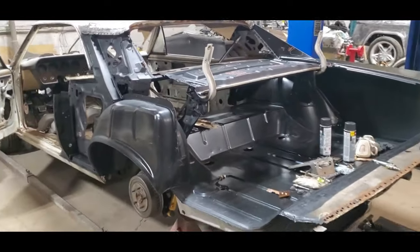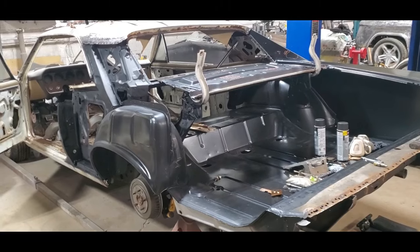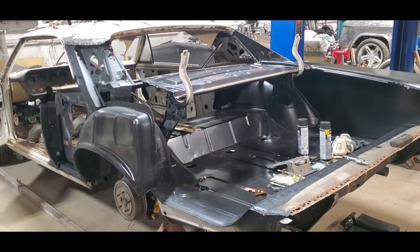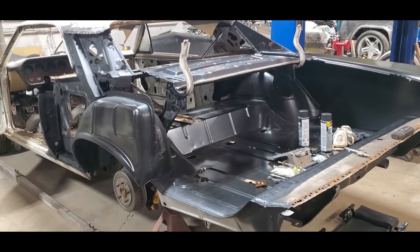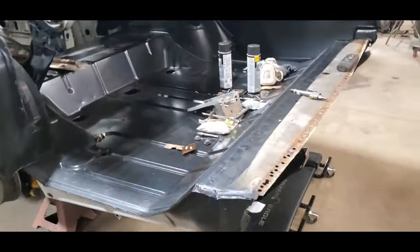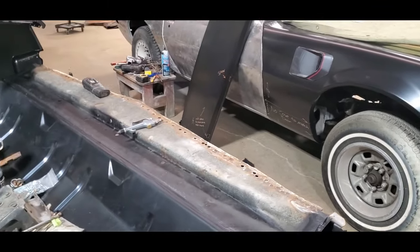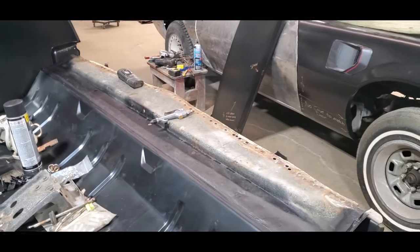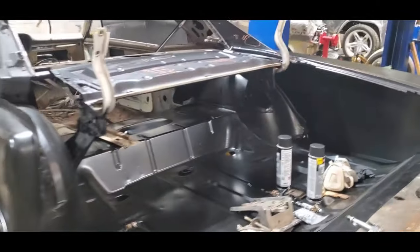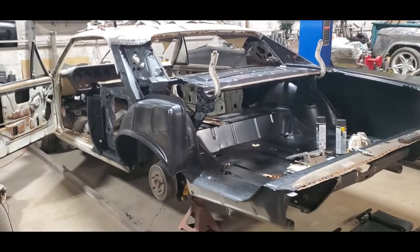It's great when people want to do stuff themselves, but as I say all the time: two things. It's great they make these parts, but they don't fit. And the second thing is, take your time — you need to have a lot of patience to do it the right way. Moving to the back here, you can see I've got the old section of the trunk pan welded to the brand new trunk floor — we had to do that, as I explained in a previous video, because the brand new trunk pan was manufactured incorrectly.